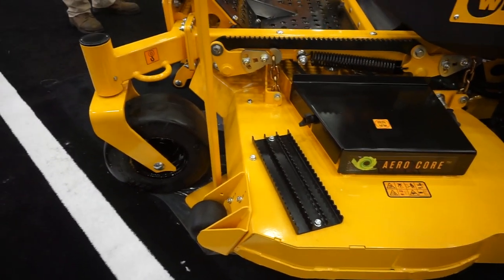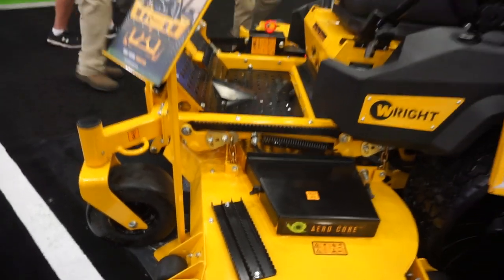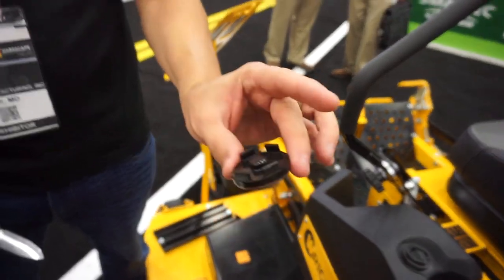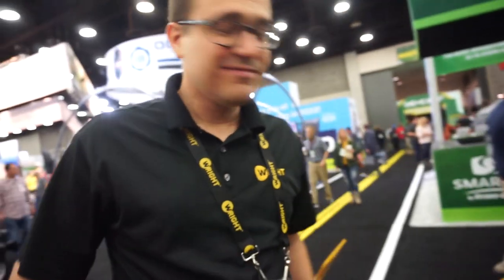There's a nice step and what we call a boot scraper. The fuel gauge is another analog back-to-the-future feature — the needle has a magnet in it and the bobber spiral device inside has a magnet. When the magnet underneath turns, the dial on top turns. This creates a separate chamber so gasoline cannot get inside the lens — a really elegant sealed design.